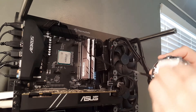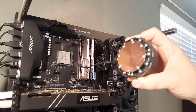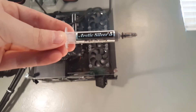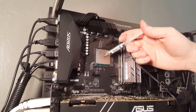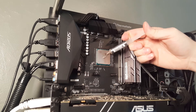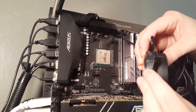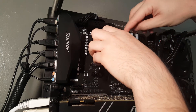Here's the copper plate — there's a line on the right-hand side, difficult to see with the glare, but that was from the side of the processor. So I'll try not to tighten one side down too far this time. We're going to use Arctic Silver 5; I've been using it for years and it's obviously a really good quality thermal compound, way better than what they use right out of the factory. I applied just a little bit more than I normally would to make sure the edges get covered.